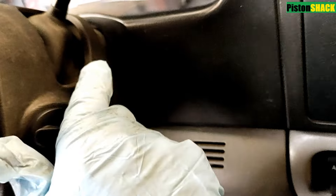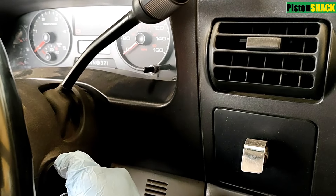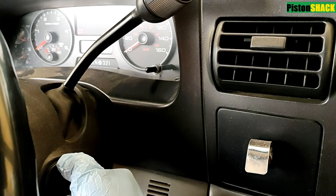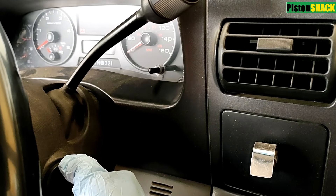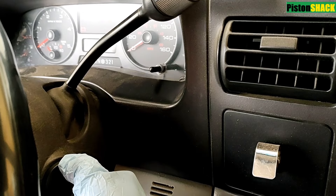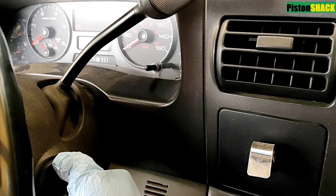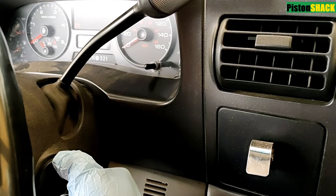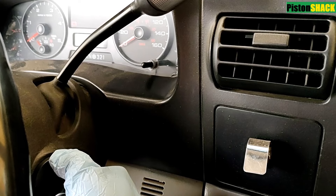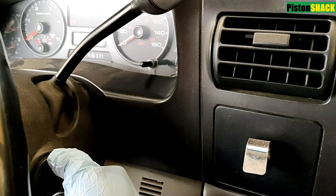Let's get into the cab. Keys in hand, put it in the ignition, and turn the ignition to the on/run position for 30 seconds. You will hear the pump running, priming the fuel. Then turn it back to the off position, and turn it back to the run position again. Repeat this step three to five times.